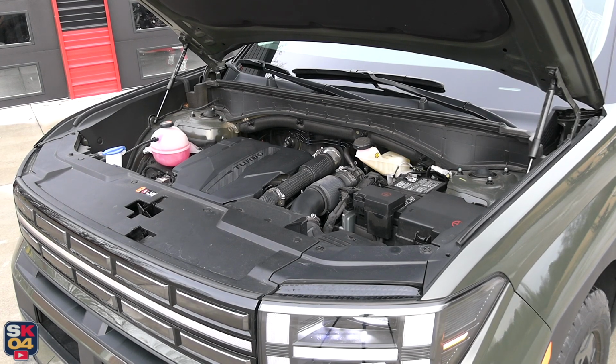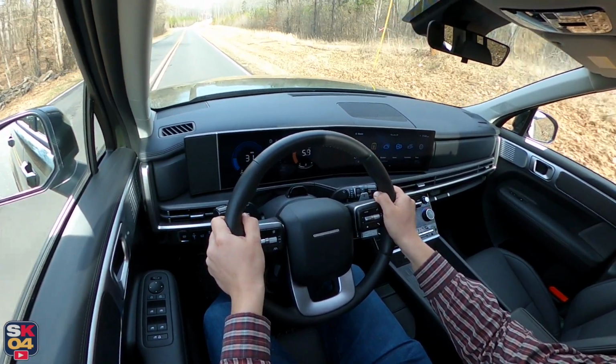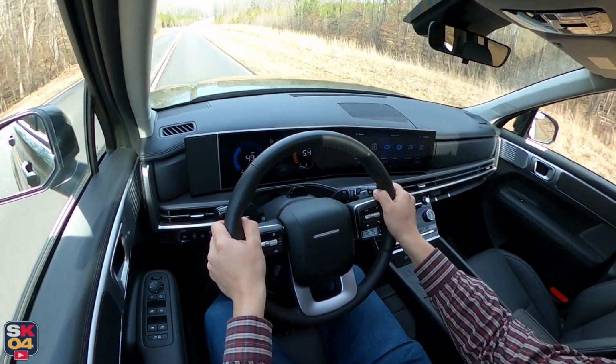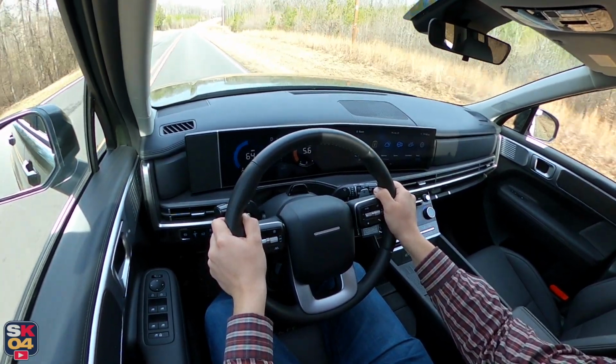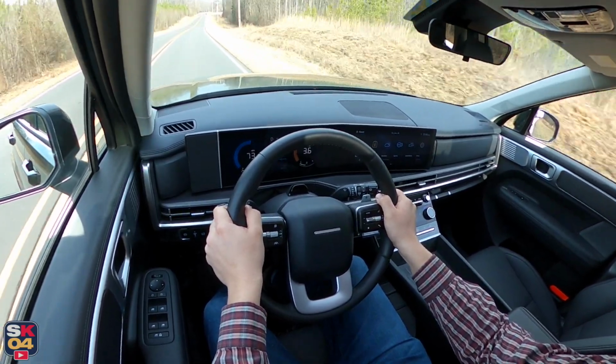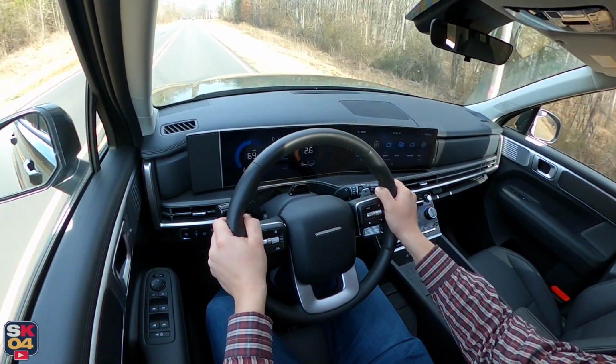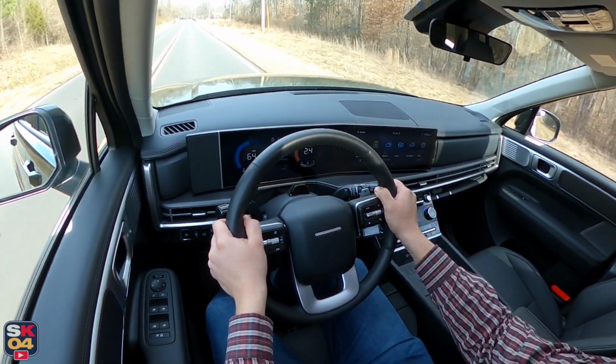The hybrid powertrain, which is not offered on the XRT, combines a turbocharged 1.6-liter four-cylinder engine, a 6-speed automatic transmission, a permanent magnet synchronous electric motor, and a lithium-ion battery pack. It's available in SEL, Limited, and Calligraphy trims. The hybrid's combined system output is 231 horsepower and 271 pound-feet of torque.